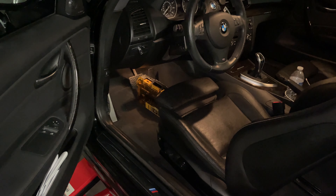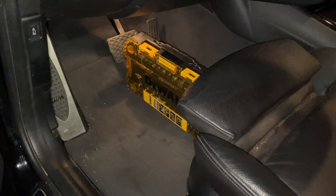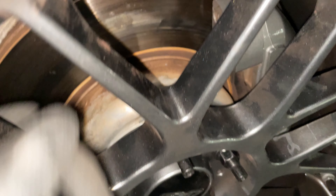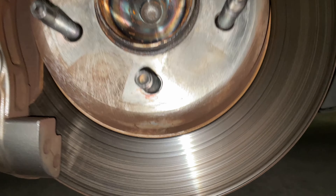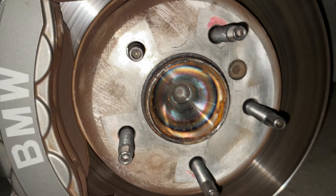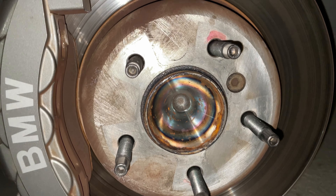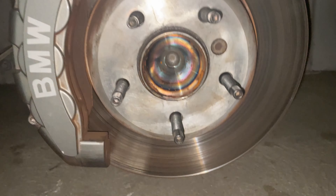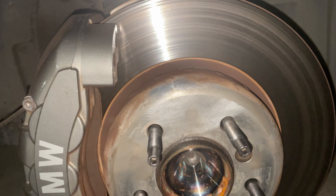Another thing people suggested is that you should torque the wheels while they're in the air — here's a little trick if you don't have a partner. On the passenger side, there's loctite right there as well, and this could be the culprit. It's a shame how careless some of these shops are and then they wonder why I'm complaining about vibration after the install. Okay, much cleaner now — no more loctite on the hub. We're going to put everything back on and go for a test spin.